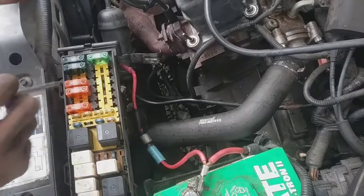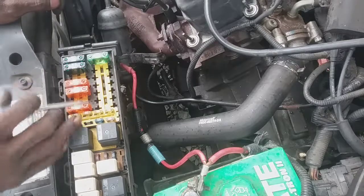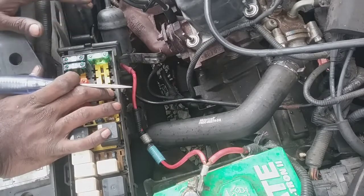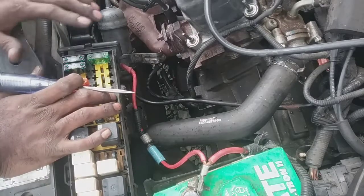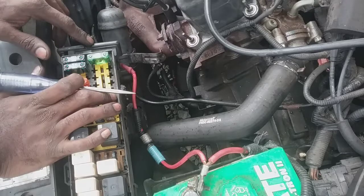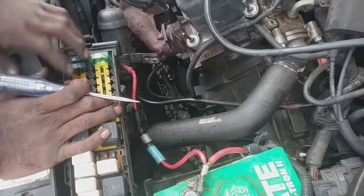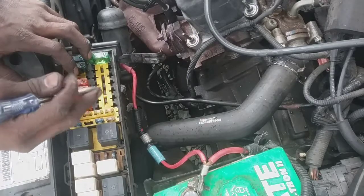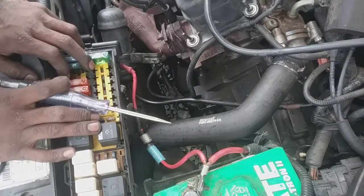So I guess this is a sign that there's some issues going on with this fuse here. Strangely, when you go to start it, it'll just blow the fuse. So there's obviously something that requires a major load that is causing this fuse to go out, short in the ground, and it only does it when you go all the way forward to the starter signal. So kind of guess where I'm going.